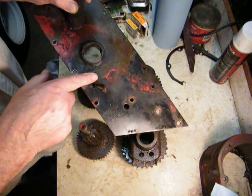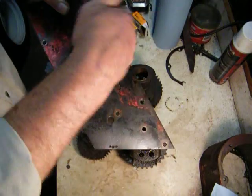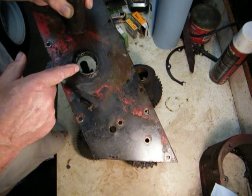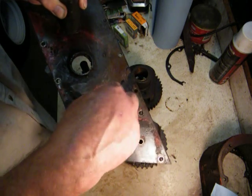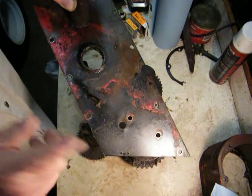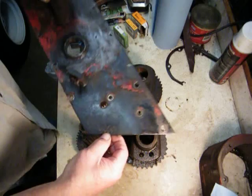This is the brake band, where the brake band mounts. On a 45 here, and this is the top part of the transmission, this would be the bottom. When it's on a 45 here, at the access hole where the brake shaft comes out, this is a 5010. If it sits here on a 90, that's a 5003 transmission and fits the RJ's 58 and 59. The difference that I'm going to get to today is this hole. This is where the brake band shaft comes out.